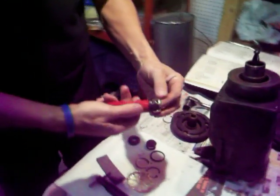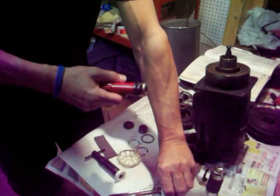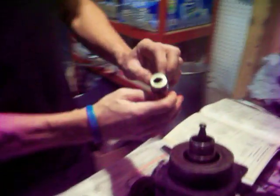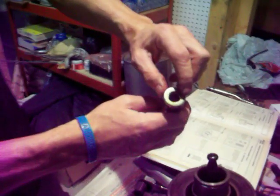These little tools — it's really quite impossible to do these jobs without the proper tools. It's an air conditioner kit I borrowed to install the seal. Now, on these A6GM compressors — these were used starting in 1962 up to the mid-80s or so — there's a slot here. This will fit down over the shaft, which has a couple of slots in it, then you turn it to engage it and hopefully the tool will release without too much of a headache.